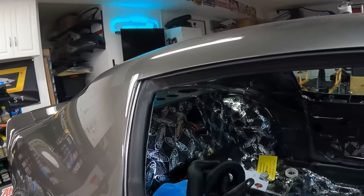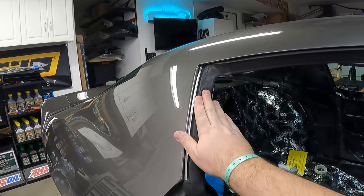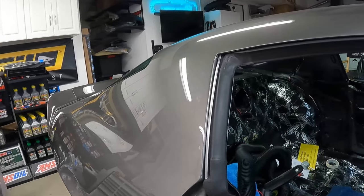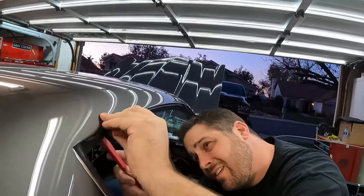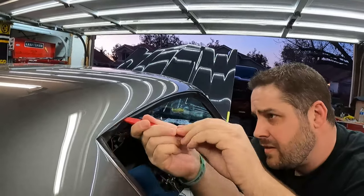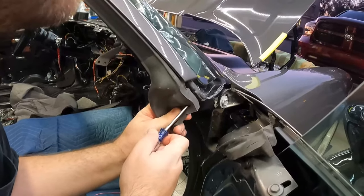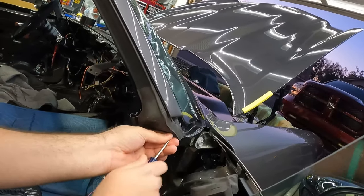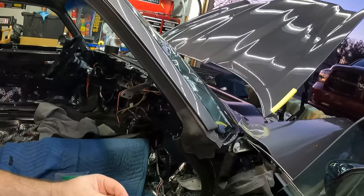Keep in mind when you put these seals in it's not going to be a perfect fit right away — it has to sit and having your window up against it will allow the seal to form-fit to the car. There may be a little growing pains; you might have to adjust or let it sit for two to three days, or even weeks. Now I'm checking the inside edge all along the top and getting the last screws in, making sure to hold the seal up against the car when tightening so it doesn't push straight through.